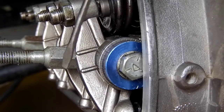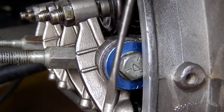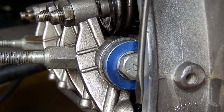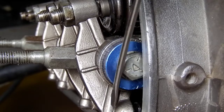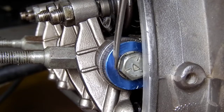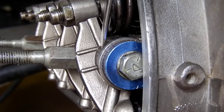The difference is from the centerline of the rocker arm to the outer edge — the edge that's being pushed down by the push rod. The push rod has a male end and a female socket to engage it, which allows it to move. It's under pressurized oil, and you can see there is a cross-fed gallery that also provides lubrication up to the shaft to keep friction low between the rocker arm and the shaft itself.